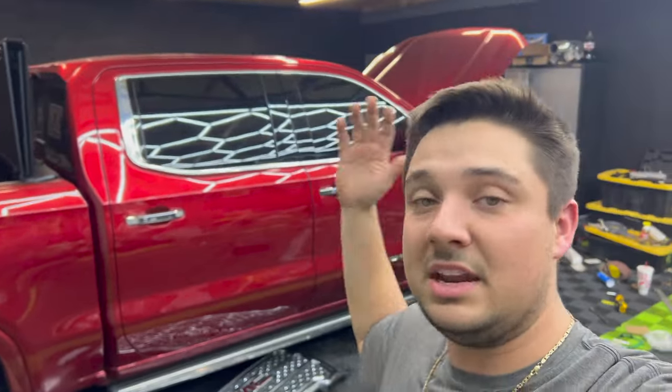We have finally finished the hot side on this truck — the turbos are mounted. In the next video we're most likely going to be rearranging all the wires because we're still waiting on our Holley lid to be able to build the cold side of the kit. We're going to wrap all the wires and reroute all the wiring in the engine bay so it does not hit these headers. Even though these are going to get ceramic coated and heat wrapped, I just don't want to burn these wires. I got black aluminum tape in so that's really going to help insulate them. If you want to see that video make sure to hit the subscribe and notification buttons — thank you guys for watching, hit that like button, and comment any questions you have about this build.